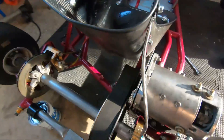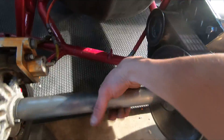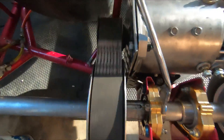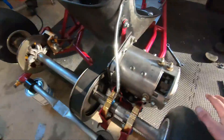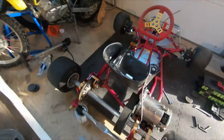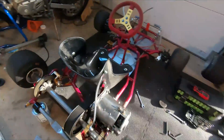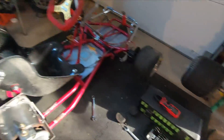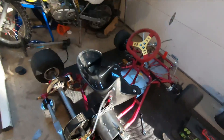The drivetrain — I'm pretty happy with it. The pulley tension is about perfect. The sprocket I welded is pretty straight, so nothing's gonna skip teeth. Everything's perfectly lined up and the brakes are good. So this is part one, and in part two I think I'm gonna mount the batteries and wire everything up, and then I might make a third video just riding it around. Stay tuned.